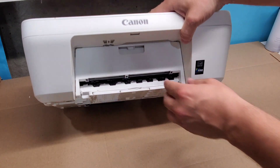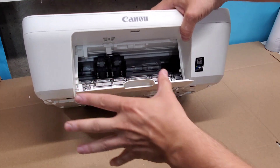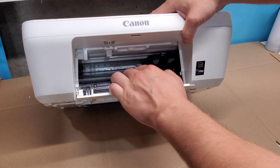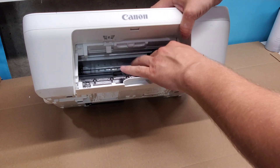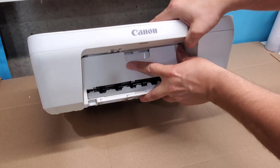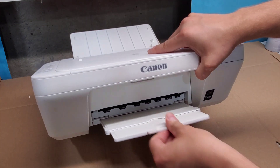As you know, the access point that is simply accessible is from here, and you can access as much as you can. But in order to clean inside of a printer — for example, that timing strip that's in the back of the carriage unit — you would need to open the top portion, and on this printer it's pretty simple to do. We have the tray here.